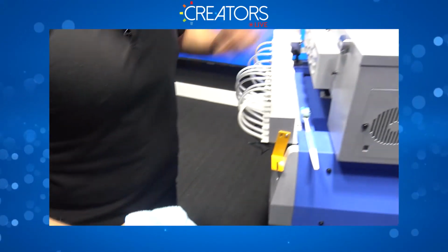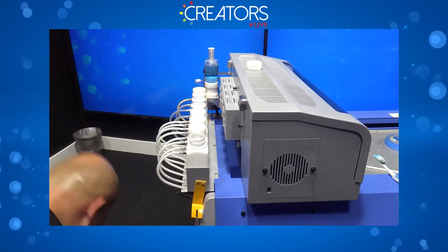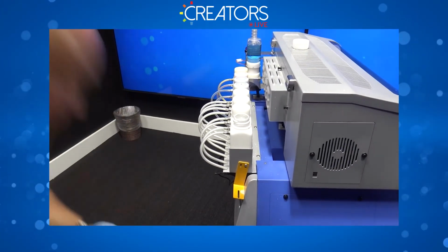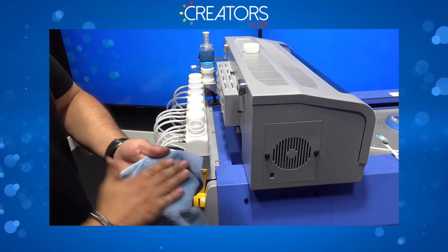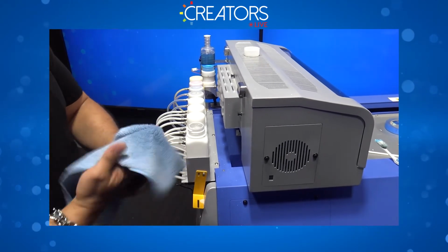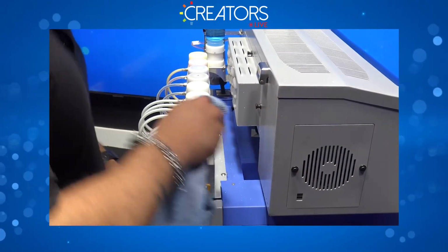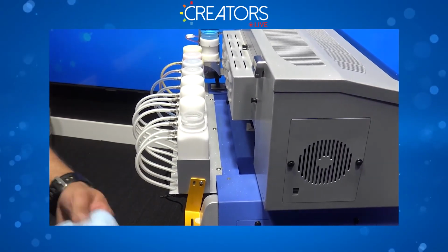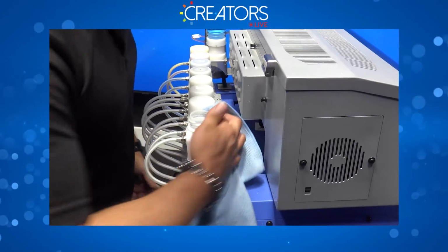All right, once you're done with your lid, by now you may already have this bottle full of ink. Maybe not, maybe you want to clean this before you fill the bottle with ink. Or you can grab your microfiber again, spray some alcohol on it, not too much. And now we're going to clean the thread around this bottle. When you do that, make sure that the rag is not super soaked, because you don't want to drip alcohol into your ink. So we grab like this, and very carefully, you're going to bring your finger in. Like that. Go ahead and switch sides. Apply a little bit more alcohol, and do the same thing.